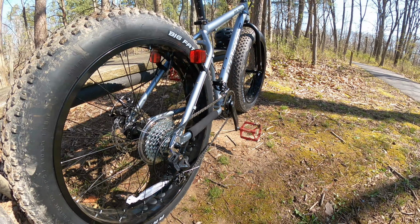And if you're wanting to buy this to potentially turn it into a one by for a budget, please keep in mind that the 1X cranksets will not fit this bottom bracket. That is made for a 68 or 73 millimeter. This, I've not measured it, but this is gonna be 100 plus. So it's not going to fit. So I'm hopefully going to look for a budget friendly option to change this to a one by if you want to. But this 2x is working perfect.